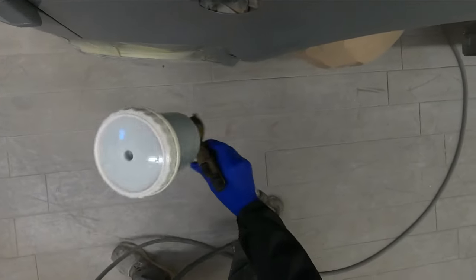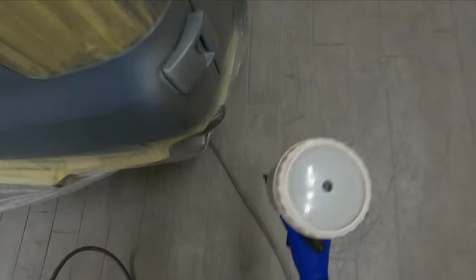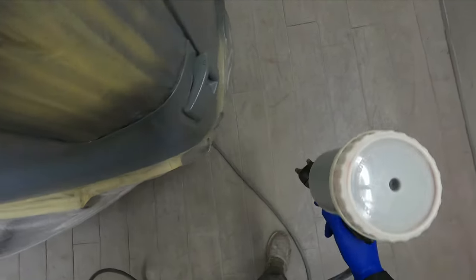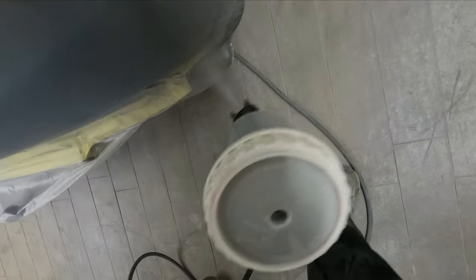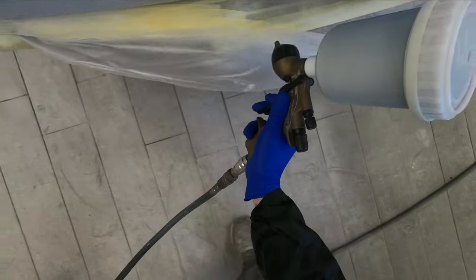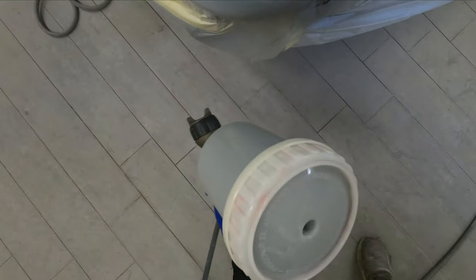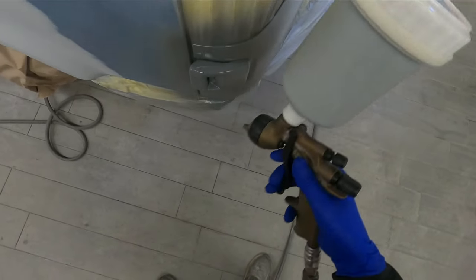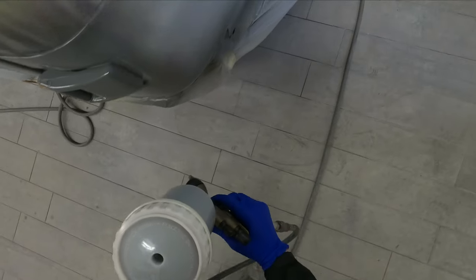This Nardo Grey in 2K is really good — it covers really well. So one single coat of this and it's fully covered. The rest of it we're putting down so we've got something to polish and we've got the depth of gloss on the paintwork, and just to make sure we've got a nice film build on there. Because if anything, when this van's done it's going to be more towards the sort of show van level of paintwork rather than just your everyday sort of paintwork on a van. So we've got to take extra care to go around all these edges, nuts and crannies, get all the little bits and pieces around the hinges, make sure all these door edges are fully coloured up.